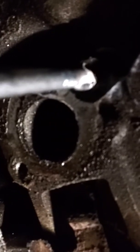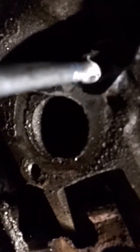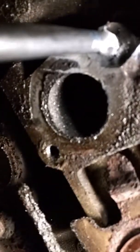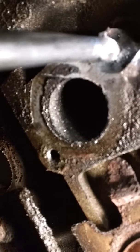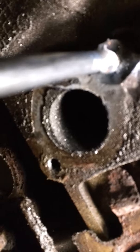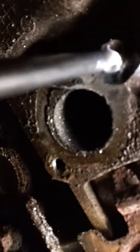And then all the way in the front here, at the back of the engine, kind of like what a dentist will do — grind away a surface to expose what you can actually work with. So I use carbide and some PB Blaster and work my way around that. Then I tack weld a stud, or a screw, or a bolt, or whatever is in my hands, to the existing piece that's inside the cylinder head.